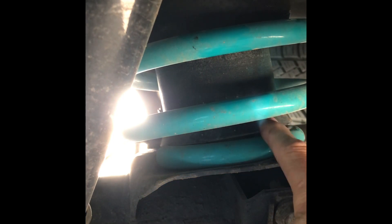It's important to note that the first time I drove the vehicle, the bags didn't have any air in them at all and I got a really loud metal-on-metal clank — all it was was this piece hitting the bottom because there was no air in the bag. As soon as I added a bit of air and pulled the fuse, the gap went away and there was no more clank. I hope you enjoyed the content. I'll be making a ton more videos on the Sequoia build, so please like and subscribe, and until next time have a good one.